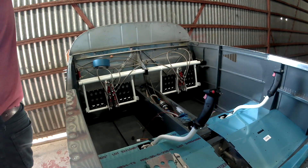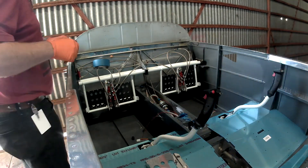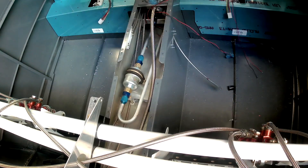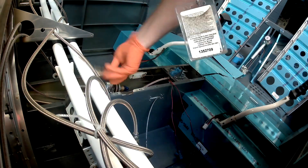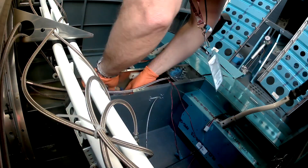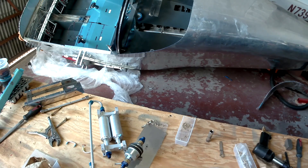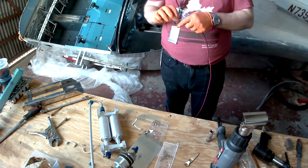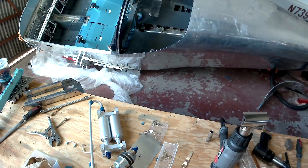As you know, this is one of the things that gives me worry — it's fuel. I'm pumping highly flammable liquids directly under my own ass and the ass of my passenger, straight into the engine. The fuel system was already in place; all we were waiting for was the return line. Fuel comes from the tanks, through the fuel selector, through the coarse fuel filter, through the pumps, to the fine fuel filter, through the firewall, into all the cylinders, then back through a fuel pressure regulator and back through the firewall into the tanks via the fuel selector again.